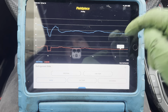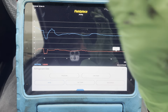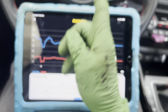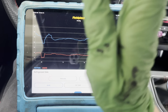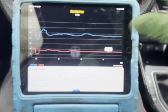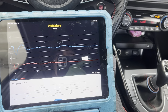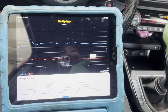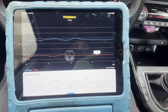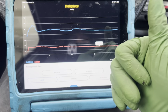Stop trying to look for rules of thumb on modern vehicles. You have to learn the year, make, model vehicle. If you do a couple hundred of them, you start noticing patterns and then you can start using a rule of thumb only for that manufacturer's AC system for that specific year and model - because on that same year, one of their other models might be doing something totally different. The manufacturers buy AC systems from other companies that put them in the vehicles and make them operate the way they want. No more rules of thumb - see you later.